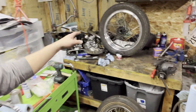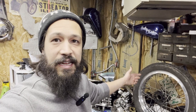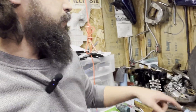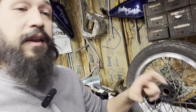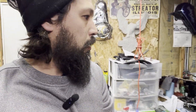On the upside, this 18 high shoulder wheel — I ordered a tire yesterday and it showed up today. I can't believe how fast that got here. I also realized, it's been a while since I've worked on the iron head, so cut me a little bit of slack. The bearings that I thought would work were for a dual flange hub — completely different design. I forgot that on these old ones they had the sealed bearing cages and there's three of them: two on your hub side, one here, and then you've got your thread-in piece as your retainer on the outer side. So new bearings are ordered.